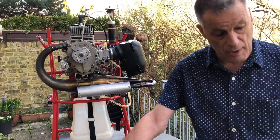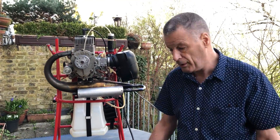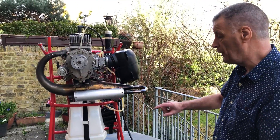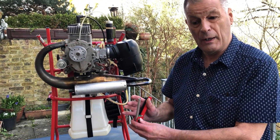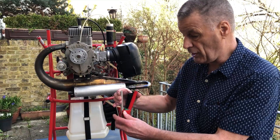We look all around us and look for any debris, because if something can be sucked into the propeller that could spoil your day. Also, if it's sucked in, the propeller can fling it at hugely high speed, which if it hits somebody in the eye is going to spoil their day. Propellers kill, propellers maim — they're bad news. Always assume that when you press the starter button, the motor is going to go onto full throttle without you even touching it. Always assume the worst.